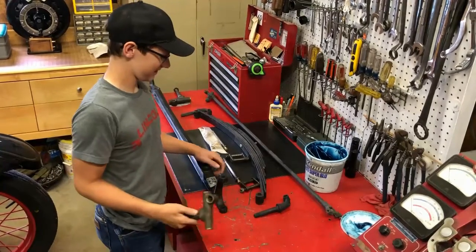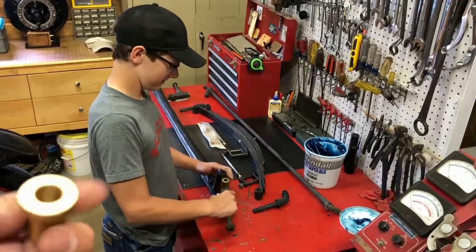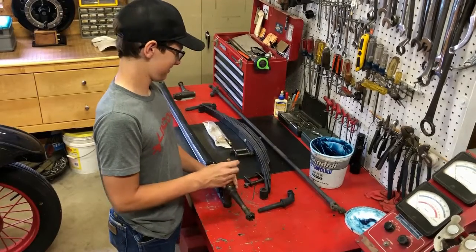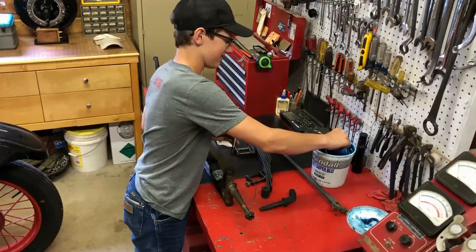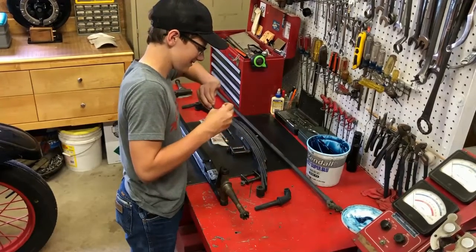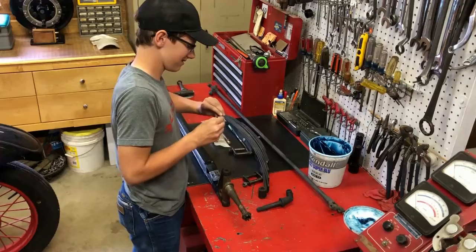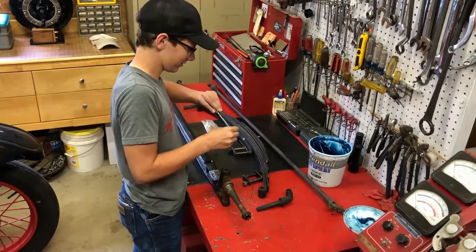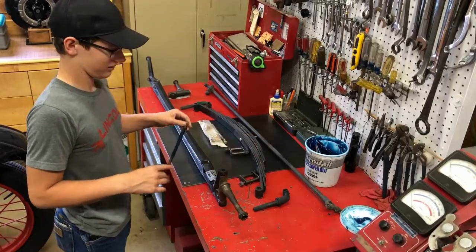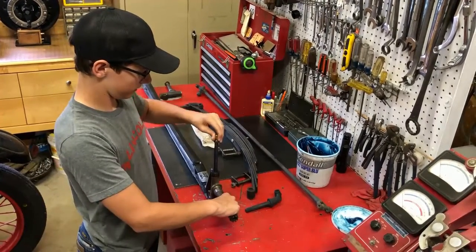So we're going to start putting the axle together and Ignatius is going to do this. We'll start with the spindles. Normally you would change these little bronze bushings that are in each end, but we've checked those out — there's absolutely nothing wrong with them; we've run the reamer down through them. Put some grease on that kingpin. He's putting the spindles in, putting an A spindle in, putting a little grease on that spindle all the way up and down it. There is a left and a right to the spindle — right side of the car, left side of the car. Basically there's a left and a right-hand thread. The left-hand thread goes on the passenger side, if I remember right.